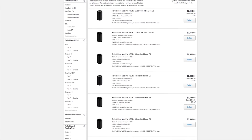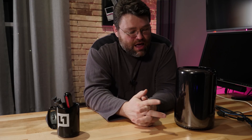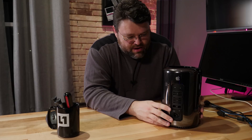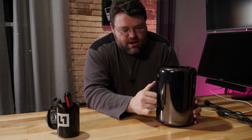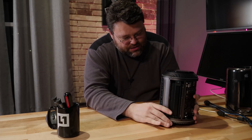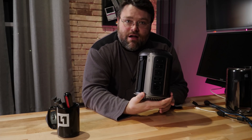Only the finest top-of-the-line X79 chipset — Xeon Socket 2011, the original Socket 2011, and maybe some Xeon V2s. No 2011 V3. It's at least quad-channel, although someone at some point paid between $3,000 and $4,000 for this machine. This is a 3.7GHz quad-core with 12GB of RAM, and it's not even a quad-channel configuration — look at this, we've got three sticks of RAM.